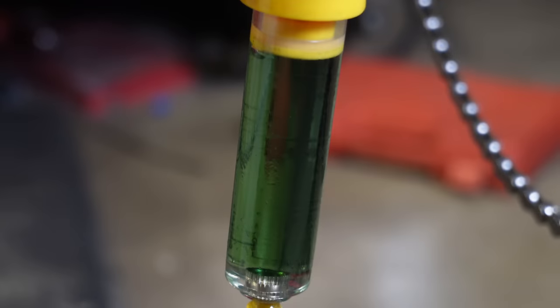Now at the rear brake I'm resetting the pistons and maintaining a good lever. The brake caliper is loose so we have to center it on the rotor. The easiest way: spin the wheel, hold the rear brake, come back here and while holding the rear brake tighten the brake caliper down. Everything should be nice and centered now — no rubs. This rear brake is good to ride.